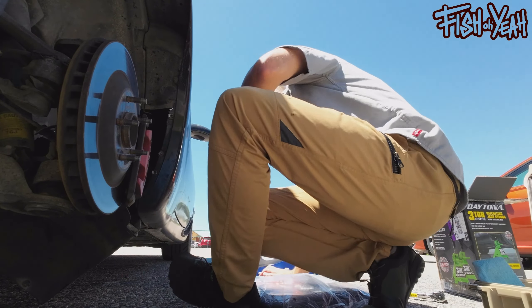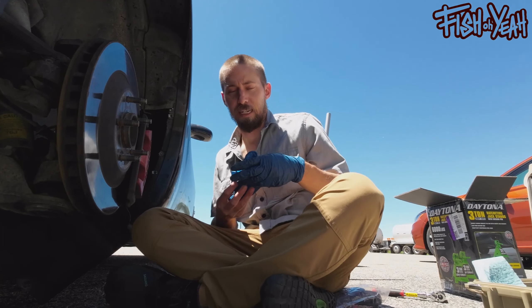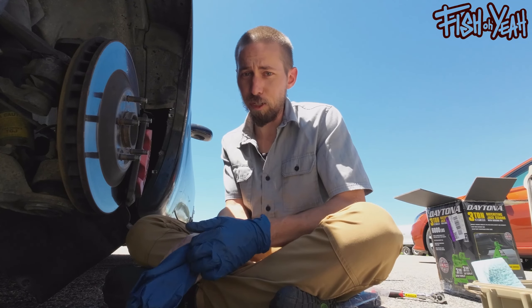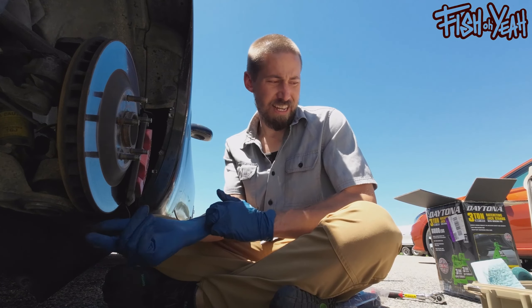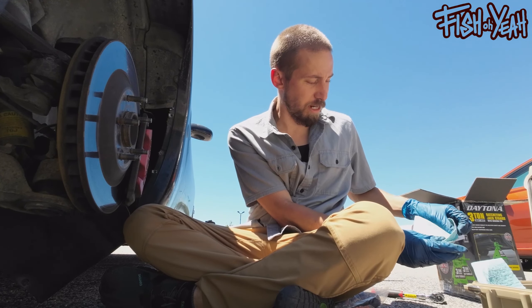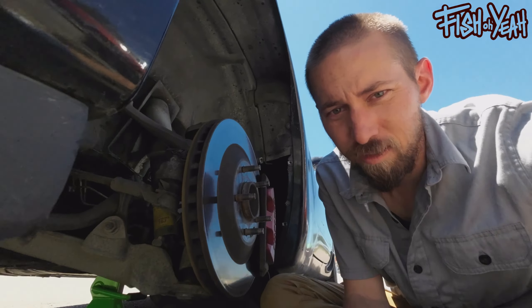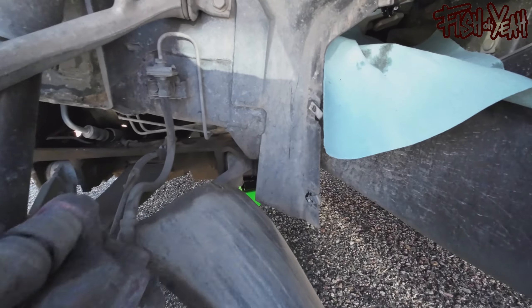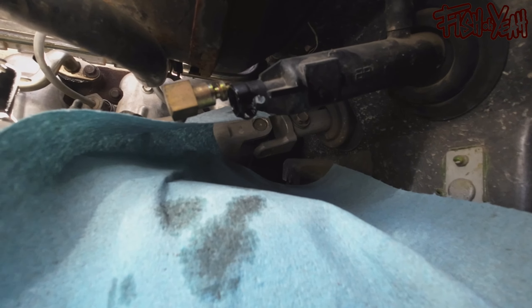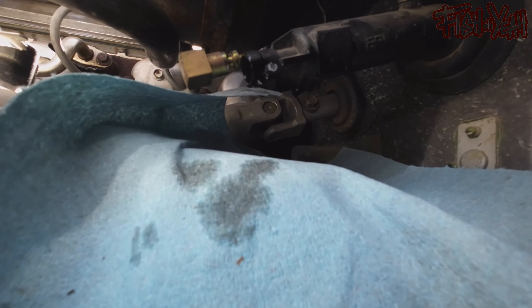And then inside, in my ramblings about some kind of weird clip — I was correct, it was some kind of weird clip. It wasn't like a circlip, it had a lot more in common with like a brake line clip. But I popped that off, used the screwdriver, popped the rod off, came right off. So now, according to ye olde internet, this master cylinder should turn a direction and then it should come out. Oh hey, look at that — Corvette. So yeah, here it is. Look — that's the line, it's not even threaded. There's a roll pin on the bottom. Neat, sure, I'll go along with that. I can appreciate that. And she turns! How much does she turn? Does she pull?